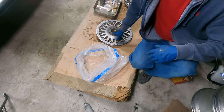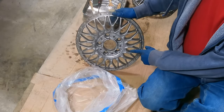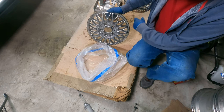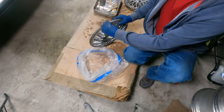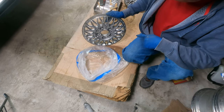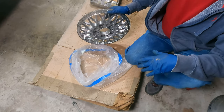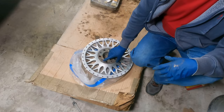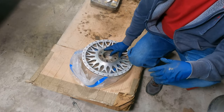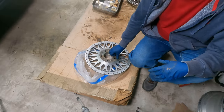24 hours later — we're going to try a new tactic. I've done three coats on the rear and two coats on the front, and there are at least three or four coats of paint on here. Basically, we've got the original silver, then a clear coat, then a primer, and then the gold paint. It's going too slow, and this paint stripper is not cheap. What we're going to try is coating it and putting it in a plastic bag. We're going to let it sit for quite a few hours. Hopefully it can just take off the rest of it and we won't have to do so much scraping. We're getting pretty close, but I'm just frustrated with how slow it's going.